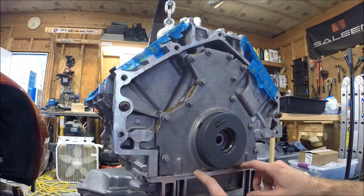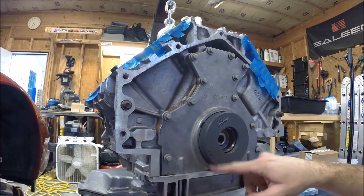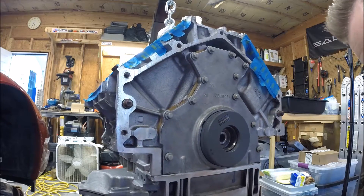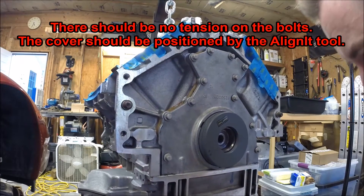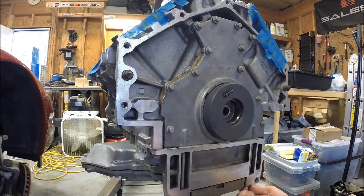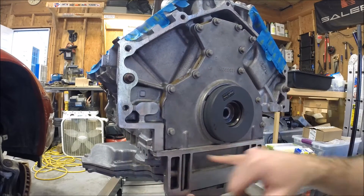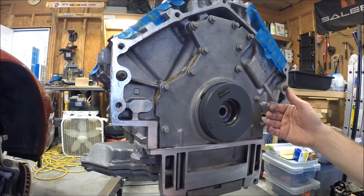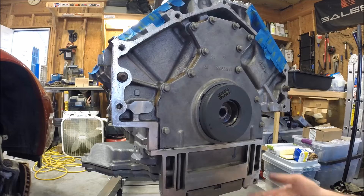Since I already had the oil pan gasket in there, I used the lower pan bolts to pull the cover down a bit so I could get the proper clearance on the bottom of the Alignit tool, so I could get it in there to position it correctly side to side. Now I'll take any tension off of these. The bottom oil pan bolts get torqued to 9 foot-pounds, then all the cover bolts get torqued to 18. We'll torque the pan bolts first to make sure we've got it pulled down flush, then torque the cover bolts in. Then we'll crack the pan bolts loose to relieve any tension in case that gasket compresses a little bit — we don't want this at an angle — and then re-torque them again.